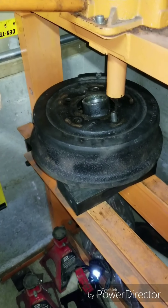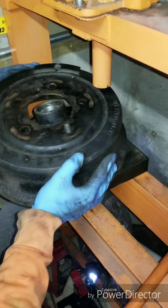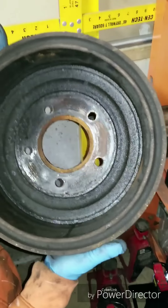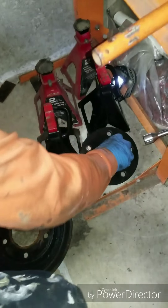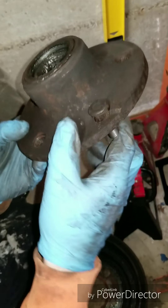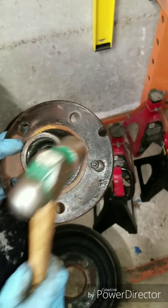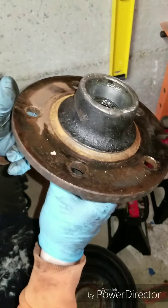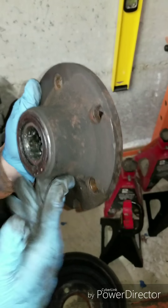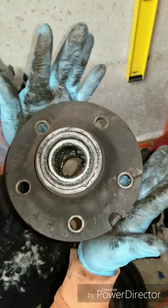We may have to push it out of the hub a little more. It's out of the drum now - that's a start. We'll just finish pushing it out - oh, never mind, it is loose, just hit it out with a hammer. Eyeballing it, it looks like it's still flat so that's good. It doesn't look like we broke the hub. So there you go - if you don't have the special bits to remove the swage, a shop press will do it.